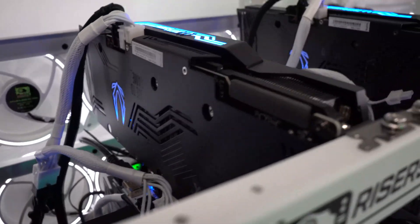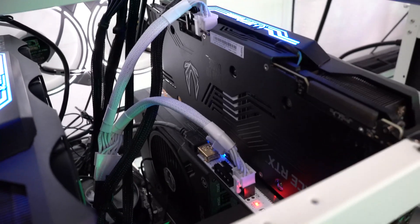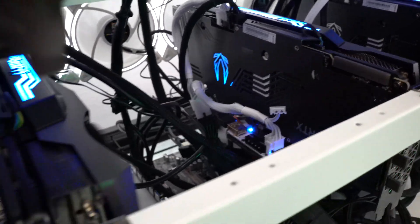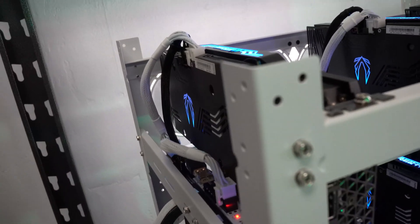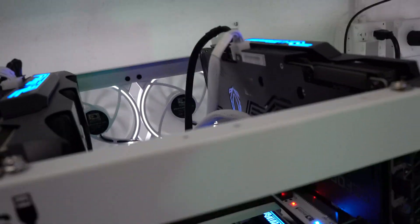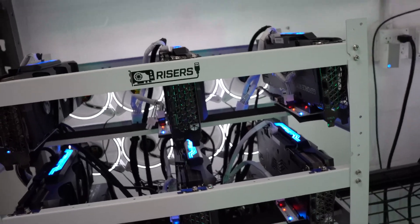You can see it's this one and this one that do not have the new pads on them yet. If you can see the white right there behind the grill, that is our new 20-watt dissipation thermal pads — we have them on the bottom three and the top one. These two do not have them yet, however they are not thermal throttling at the moment, though they are right on the edge of it.